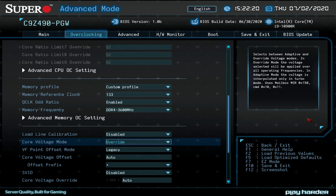And depending on your response or a transient response or something like that, you could actually cause a system to lose stability when you transfer from no load to a really heavy load suddenly. That kind of stuff can end up kicking you. And that's not to say you can't tune it out with adaptive voltage. It just gets to be a lot more tricky and a lot more time tuning. You really got to figure out exactly how your platform works.